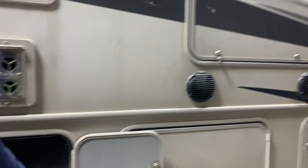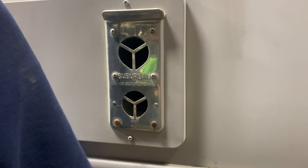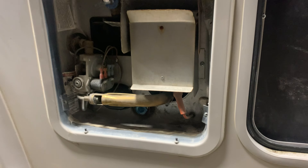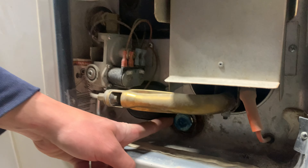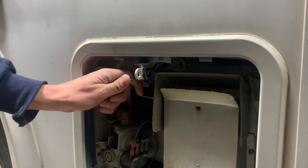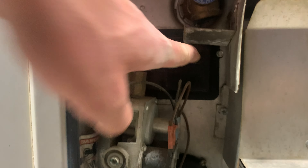Whenever you're running your furnace, you are going to be pushing out hot air out of this silver outlet here, so just be mindful of that whenever you have stuff underneath your awning. To get inside here you're just twisting and pulling that off — it gives you access to your service panel for your hot water heater. You've got an inch-and-an-eighth drain bolt down at the bottom; take that out and it's going to completely drain the system. Whenever you first get to your campsite, you're just going to want to give this pressure relief valve a pull — there should be a shot of water that comes out, letting you know that it's full. We currently have the tank empty for the customer to pick up, so that's why there's no water coming out. I'm going to go over the reset procedure inside — the button I'm going to refer to is just right there.